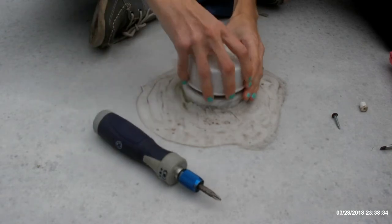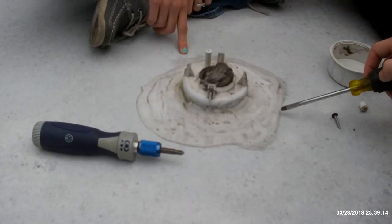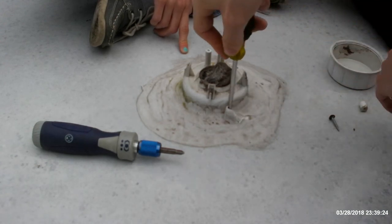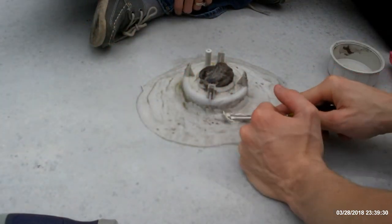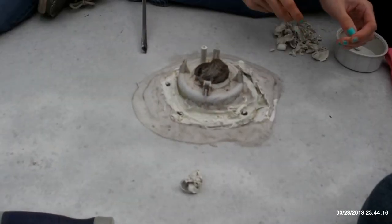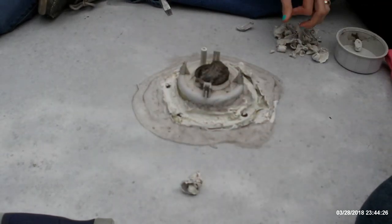So once it caps off, next we got to remove all the sealant around here so we can access underneath it, to remove the white cap and then replace it with our 360 siphon vent. Be careful not to puncture the actual roof if you have a rubber roof. Let's go along easy. Our next step is to remove each of the screws — there's four of them. Now we can pry that whole thing off of there.